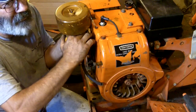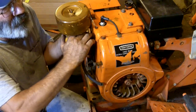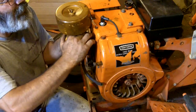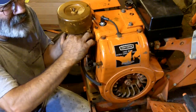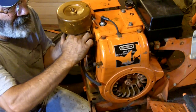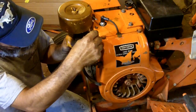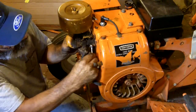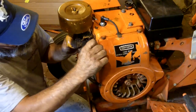And once it's tight, the bolt ends up hitting right against the body of the carburetor. So before it's tight, there's not enough room between the bolt and the carburetor if the carburetor is all the way against the engine. So we put that one in and do this tedious task of a finger from each hand to tighten it up, 1/8 of a turn at a time. Not a lot of room for tools in here. Can't even use the box end because the wall is too thick to fit in there. You can't get the wrench on it. But at least we can get 1/4 of a turn each time we put that wrench on there.